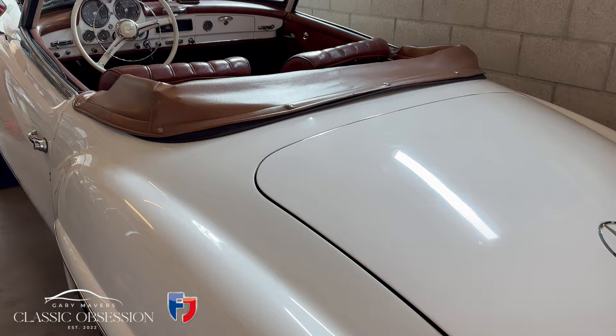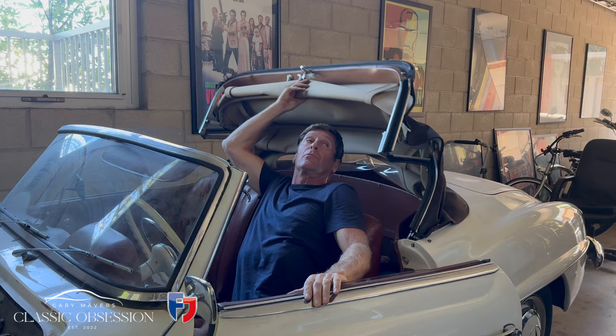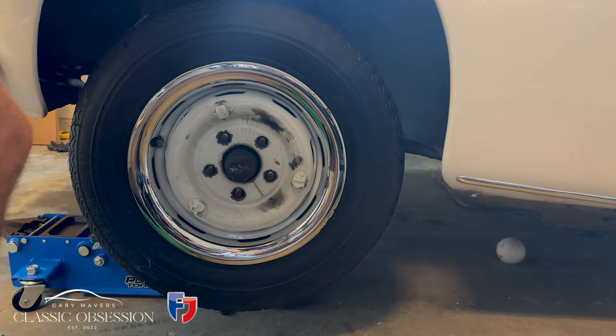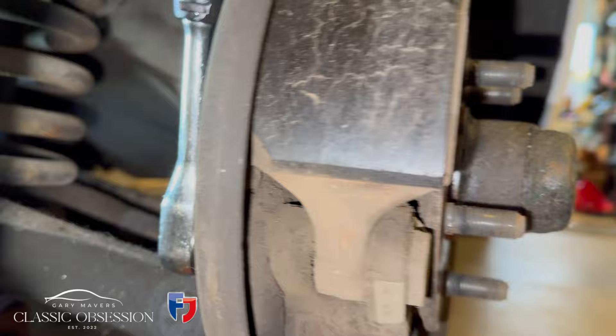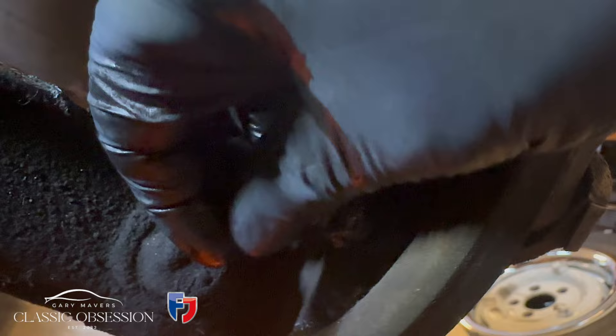Welcome back everyone. In our plight to bring this beautiful 190 SL back from the dead — originally just dropping by to try and get the car started for owner Dan — it clearly became apparent this was a full-on restoration. I thought maybe it was a bit more than I could chew, but I'm in too deep now. So let's crack on. Getting straight back into those rusted-up brake cylinders: off with those springs, and be careful — there's a lot of tension in these. Off with those banjo connections, careful not to lose those crushed copper seals, and let loose that dirty old fluid.